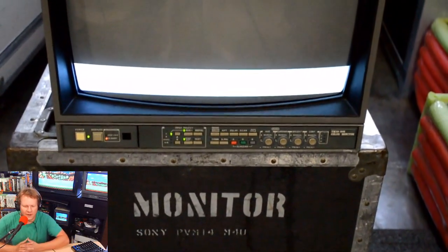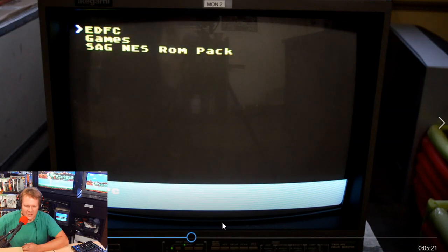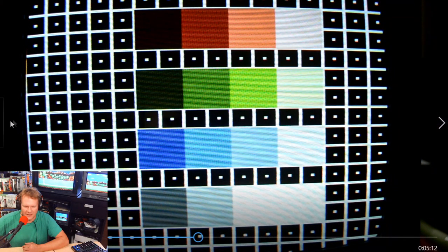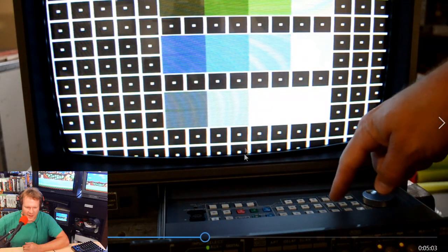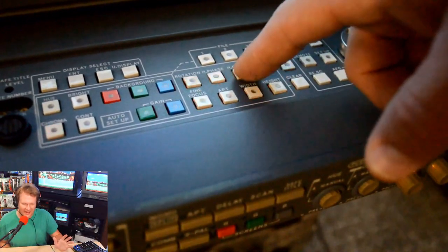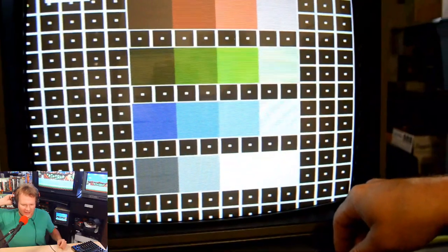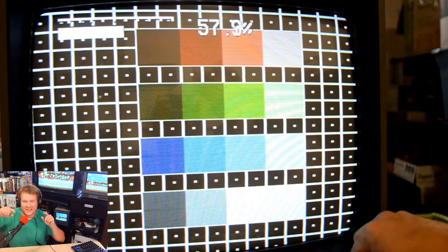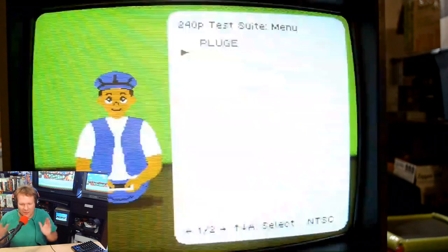Here we have the monitor turned on with a picture in it, so I can show you a little bit of how this tube looks. You'll notice it has that rounded glass edge on the front as well as the sides — that horizontal curve is always present on CRTs unless it's a flat-screen CRT. This one also has a vertical curve, which is the shadow mask tube technology. Here's the button pattern — you press it to activate it and all the buttons light up. You pick your adjustment, like horizontal center for example, then spin the wheel to dial in your exact geometry setting. You get a lot more control because it moves in very small increments.